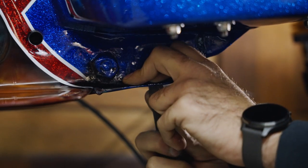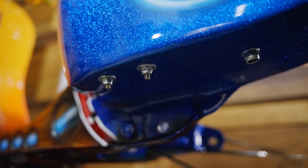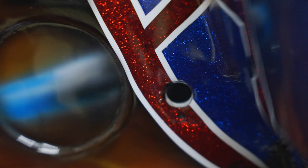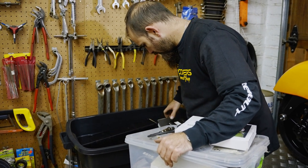We could put the fork into the bike and really start putting everything in place. There are a lot of moving surfaces that need a thin amount of clearance and the tolerances have to be precise. Paint obviously adds thickness across everything, so there's a lot of time spent tapping holes, cleaning paint out of clearance holes, and getting surfaces back to the right tolerances. They didn't know how I built it, so I had to go through and do all that paint prep myself.